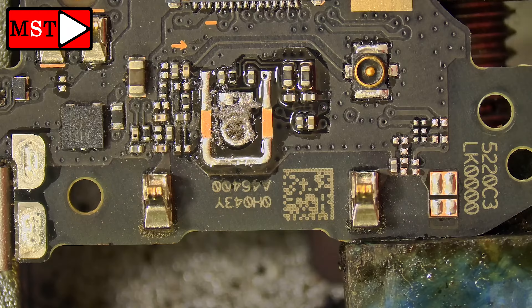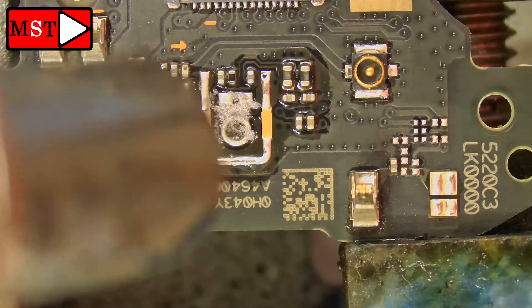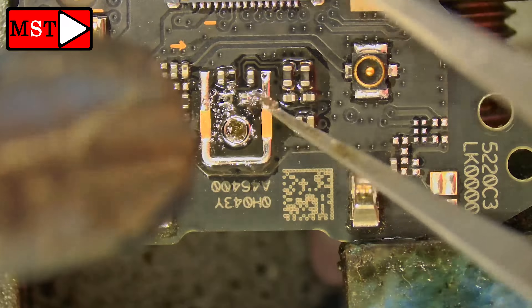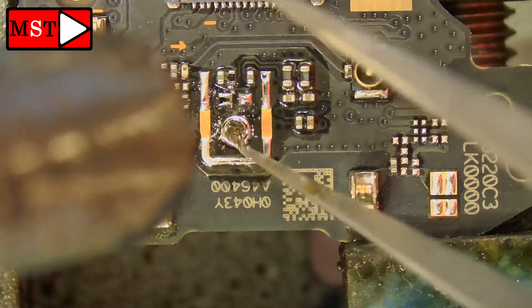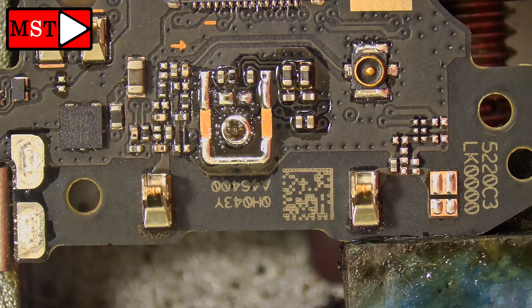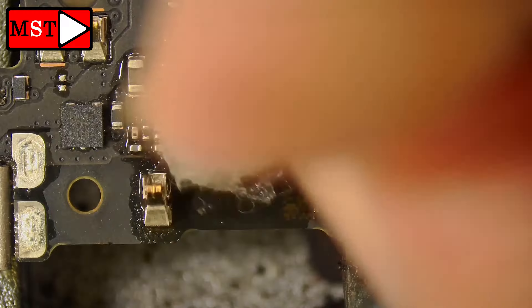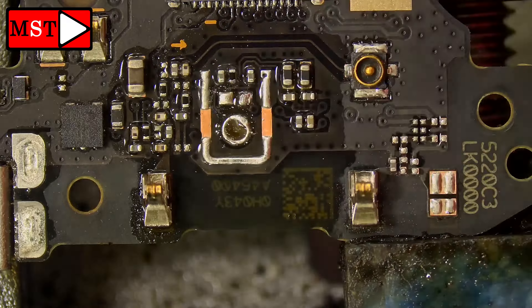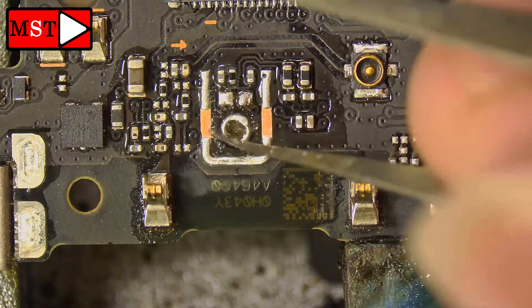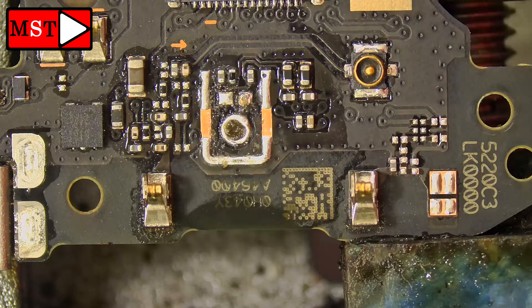I have two models — 183 degrees and the second is about 260, I can't remember exactly. The new microphone can't survive high heat so it could be damaged during the operation. It's recommended to use low-melt solder so you can solder the new microphone. It's a very difficult job even if you've done it many times — it's not easy to replace a microphone. It's very sensitive and you may damage it. You can test it with a multimeter to see if it's still working.